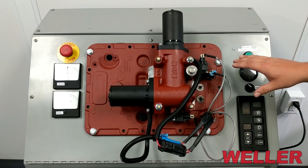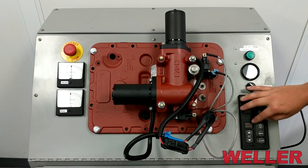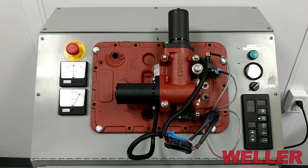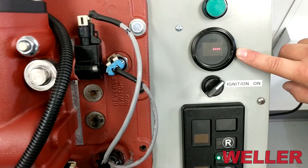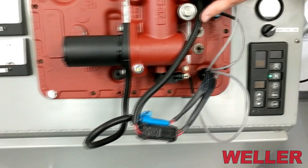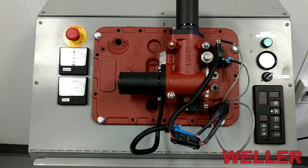We have preset the condition in the shift bar housing. I'm going to turn the ignition on and we'll see that F and that service light here. There's our dash — and if you can hear the XY shifter is pulsing pretty hard. Watch our current gauges over here: that motor is trying to go but it can't.